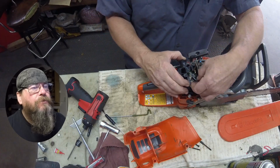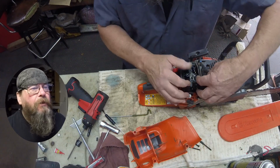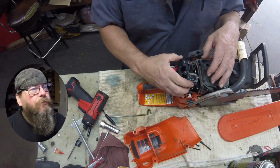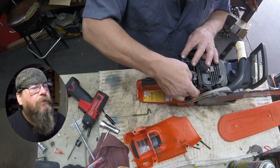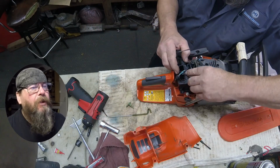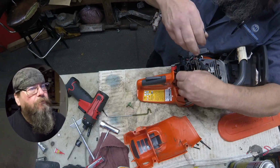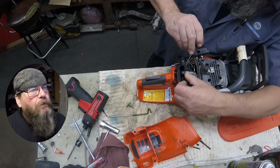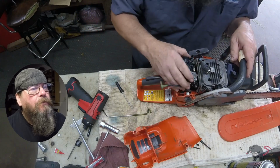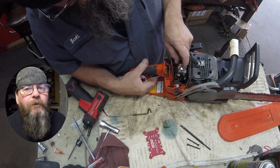There's a wiring harness for that auto-tune wiring plug. It's kind of clipped on top of the carburetor. We can just snap that out of its clip. And we've got a fuel line that's kind of clipped into the back of the air box. And it's the return line from the purge bulb back to the tank. So we're going to pop that off the back of the purge bulb. Get it out of the way. Pull our air box out. Try not to drop it.